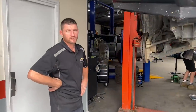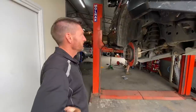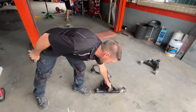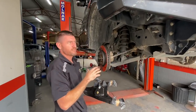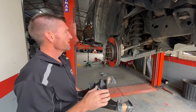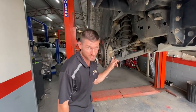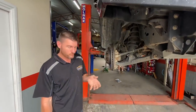So we might as well ask the master here. We're going to be doing a two-inch lift. A lot of people ask how to do it, so let's just do a video. I'll do a brief discussion on each corner. The lower control arms get replaced - this is where the two-inch lift is achieved, so we don't have to worry about coil springs with HBMC. When getting this system undone, I like to leave everything out of the way so we're not trying to fight to get the ball joint undone or pinch a CV boot. I've done it this way since day one with no dramas.